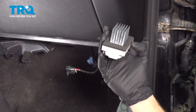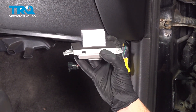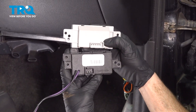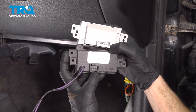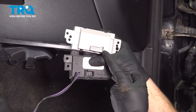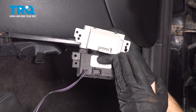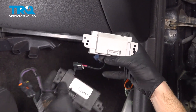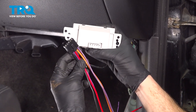Let's get ready for installation of our brand new blower motor control module. What you're going to find is that the electrical connector along the back of the brand new one is a little different than the original, and that's okay because your new one came with a new wiring harness. I'm going to show you how to connect everything now. You remember that the purple and black wire went to the blower motor — keep that in mind.